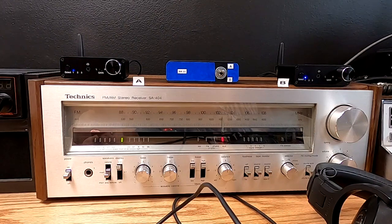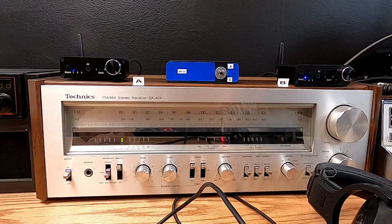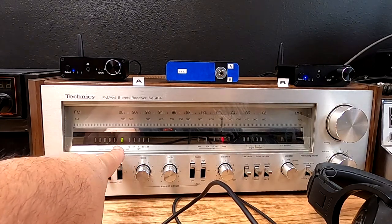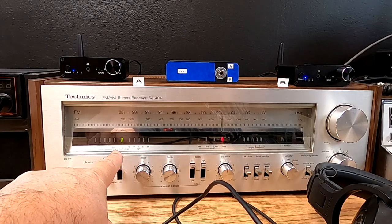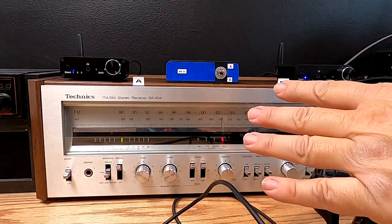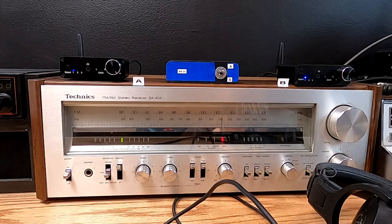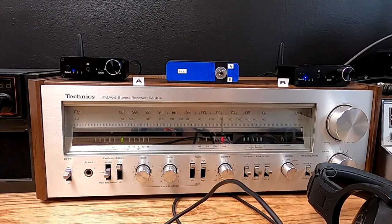In this test, we're going to see the audio level, because one is a little bit hotter than the other — one has a little more output. I'm going to play a 1000 Hz tone and go back from A to B. Watch the relative output meter on my old receiver. This is more of a real-world test; the way I've got the gain set on my computer and the volume control, you'll be able to see the difference A-B-wise.